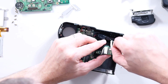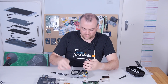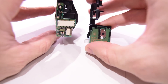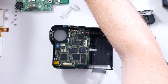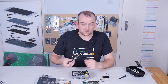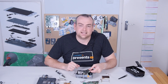Direct feed off the battery module to the charging module, which makes sense — you've got a high power, high current, fairly noisy draw coming off of the battery, so it makes sense to keep that segregated from your relatively sensitive optical signals. There's a little flash capacitor. That's for the trigger button and a tiny daughterboard, then using a ribbon cable onward — so the shutter goes through two daughterboards as a pass-through. I guess it simplifies wiring, but that's probably two extra connectors you didn't need. Along with having to use a floppy disk — which I have mixed feelings about, because the format itself is flawed but its availability made it a good thing — it's weird to me that there is no data output from this. You can't plug it into a computer for digital transfer.